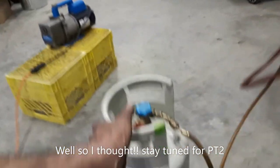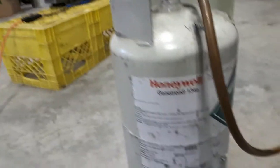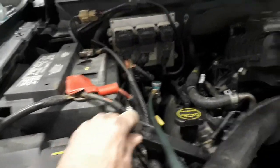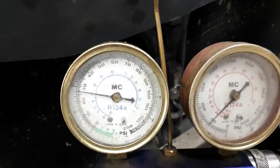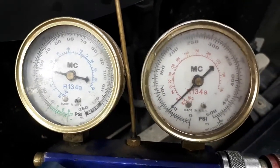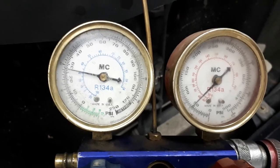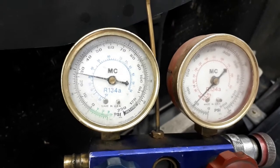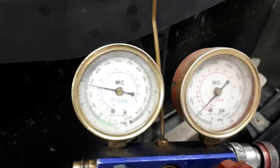Refrigerant 134A - that's the prescribed medicine for this old truck. Here's our refrigerant 134A gauge set with the quick release hoses. I already took my discharge hose off, but we were running a perfect 125 PSI head pressure. With the door open and the AC cranked, we're running steady at about 27-28 PSI suction - a real nice pull coming out of the unit inside.